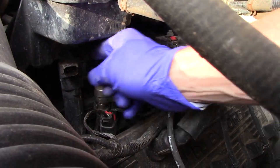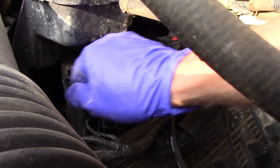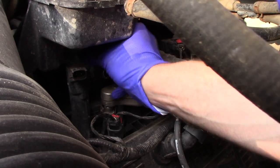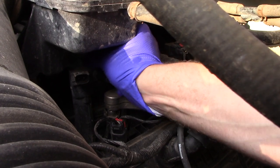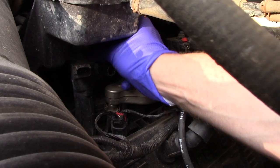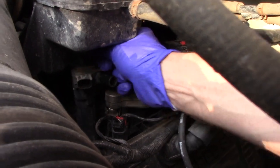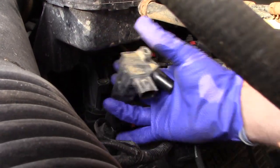It's not a bad idea to replace all these when they start doing this, but this engine's only got 50,000 miles on it, so it's kind of strange that this problem has developed. Usually that means there's some corrosion down in the bottom of the boot, so the spark's looking for an alternate path, or the silicone has just broken down or been damaged. I did not have any check engine lights or any noticeable drivability problems. I was able to get that out — it's all tight under here — and pop this out of the hole.